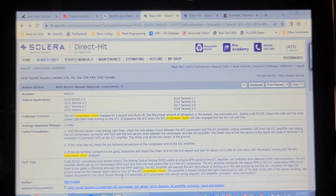After the road test, the air conditioning works perfectly fine and the B1422 hasn't come back. I did a keyword search on Identifix and found a tech tip: the ECM sends an engine RPM signal to the AC amplifier via the CAN network. The AC amplifier gets a compressor RPM input from a lock sensor inside the compressor, then compares both RPMs. If there's too great a difference, the AC amplifier assumes the compressor is locking up or the belt is slipping and removes the ground from the magnetic clutch relay to shut off the compressor clutch. So with the drive plate failed, compressor RPM was zero — that's exactly why it set the B1422 code.